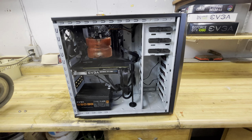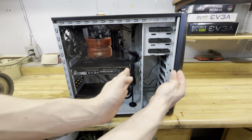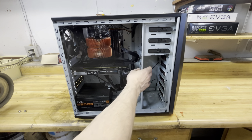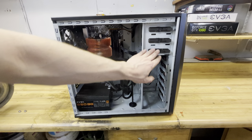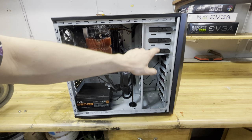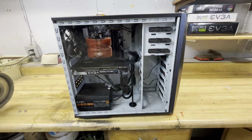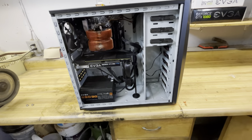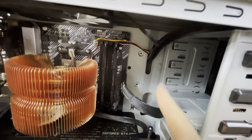There are a lot more holes for cable management so I don't have cables snaking all over. The cooler is obviously different. The hard drive cage is a big area where things have been changed — on the original 300, the hard drive cage was basically flipped so the drive slid in through the back, which made the cage reach further into the case and made it harder for bigger graphics cards to slot in. The five-and-a-quarter bays are now tool-less and spring-loaded — you just slide your drive in and it snaps in. There are actual cable management holes to run cables through, which I've obviously used.